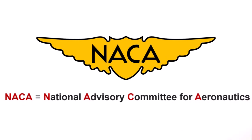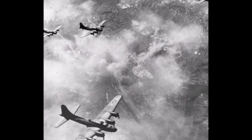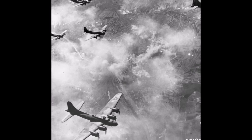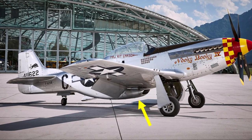NACA is the National Advisory Committee for Aeronautics and the predecessor of NASA. Their job at the end of the Second World War was to develop a submerged air intake that doesn't increase frontal area but still provides lots of air. Until then, aircraft used RAM air ducts that provided good amounts of flow but also increased drag.